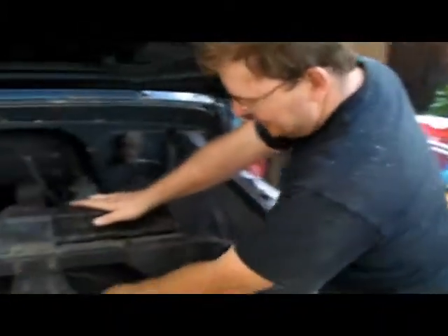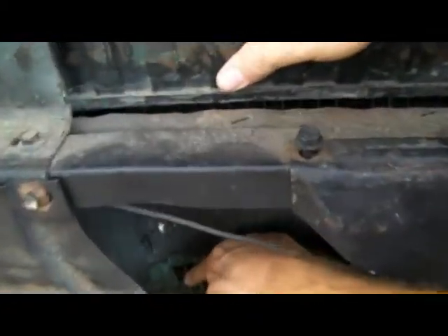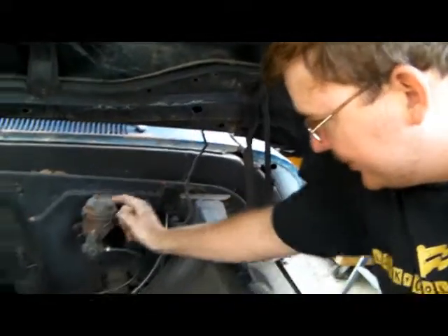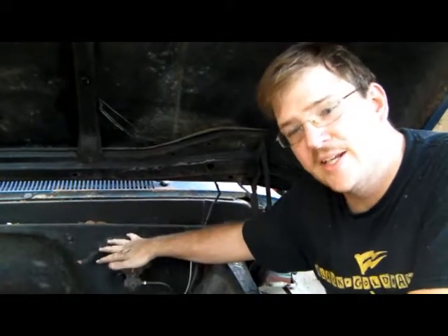You can see right here we've had a bit of evidence of a leak in the radiator. I haven't lost any significant amount of fluid for a long time, but we may end up replacing that as well. About three or four years ago, Mike and I did a complete brake system from the master cylinder — all new lines all the way down to the wheel cylinders, new drums, new shoes, new hardware. I may eventually convert this into a split system with a proportioning valve so you've got front and rear brakes, and if you lose brake fluid in one, you're not dead.